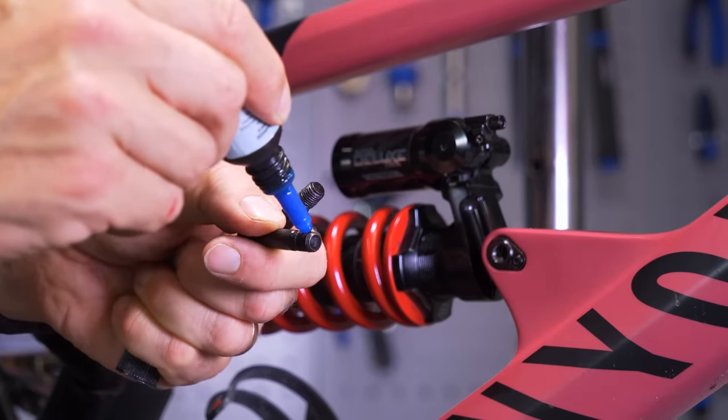Likewise, the opposite can be said if you have a spring that's too firm — the bike's not going to be nice and supple across the terrain, and you're essentially going to be pedaling around a heavy spring with no good reason. Get the sag dialled in correctly. For this bike, we're aiming for 30% of the available travel as sag. Getting that sag measurement is also quite different — it's not like an air shock where you just put the O-ring up against the shaft.